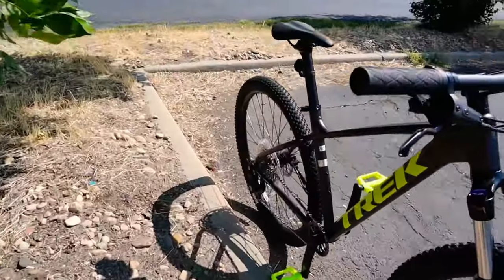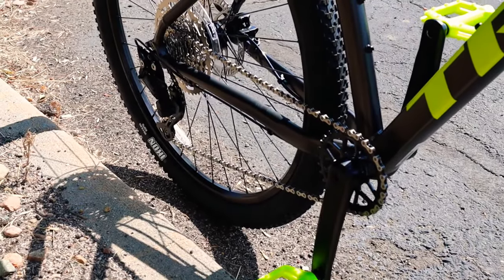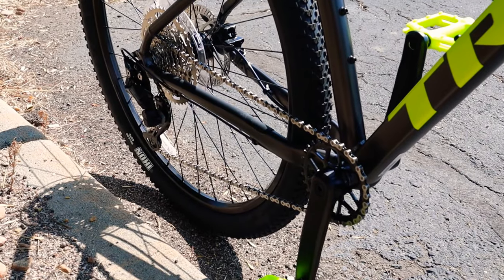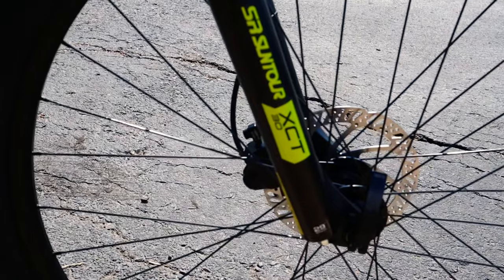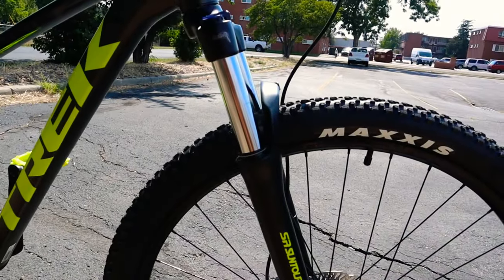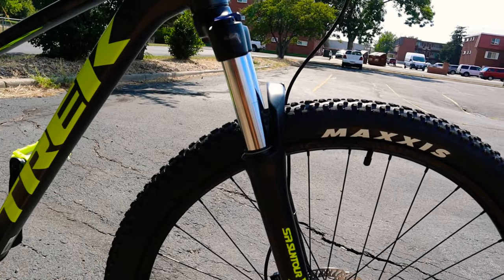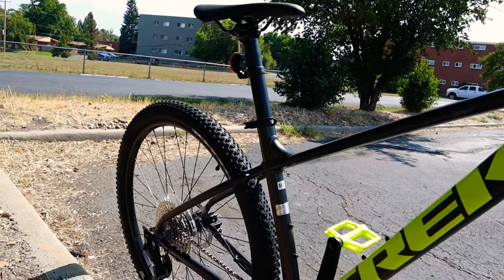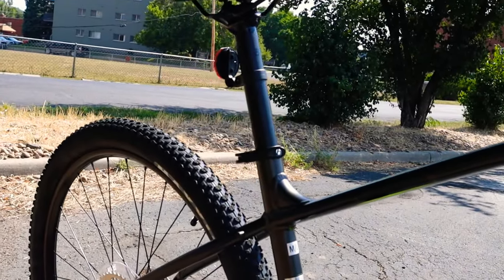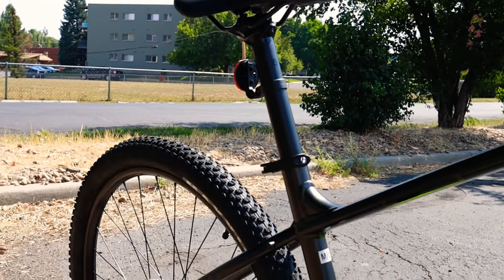The fact that it has the 1x drivetrain is huge for me. With a 1x drivetrain like this you can actually take this bike serious and really take it on trails — not super technical, but some blue trails, mostly green — without any issues. It has the SR Suntour XCT 30 fork, about 100mm of travel, so not too bad. It's not the best but it's definitely capable of lots of different terrain. One thing I want to do on this bike if I get it is to add a dropper post — I'm not sure if you can route it internally, but I'm gonna ask them.